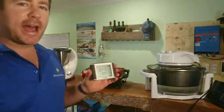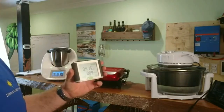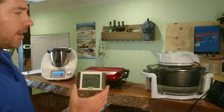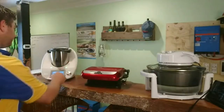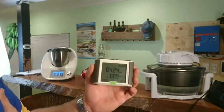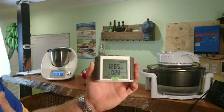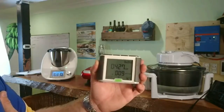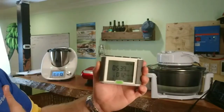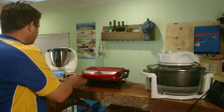Now this one here monitors my whole house. There are some really good ones — we've actually got a new one being installed that will track our solar production and energy usage, all available online, which we'll give you viewing access to. So clicking on the Thermomix here — at that moment our house is using 400 watts, meaning over an hour we'd use 400 watt-hours from the battery. Now it's jumped up to 1265 watts, so the Thermomix is using about 800 watts. It's very efficient — it fluctuates up and down as it heats things.